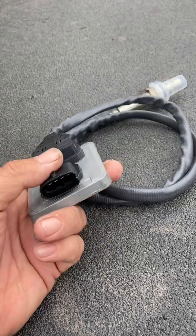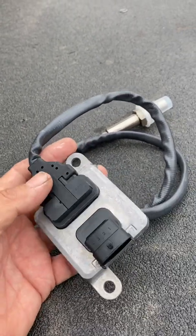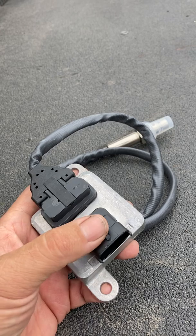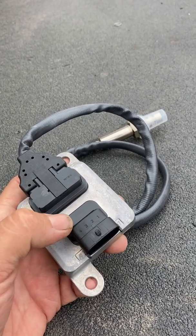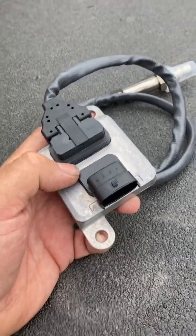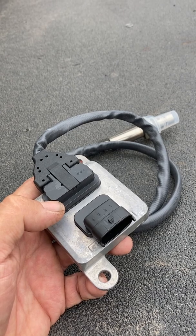This can also be part of a CAN bus issue. It normally doesn't affect the CAN bus, but since it's part of that circuit, keep in the back of your mind that it can interfere with the CAN bus signal. You would have associated codes that point you in that direction toward this sensor. Leave a comment — appreciate it.